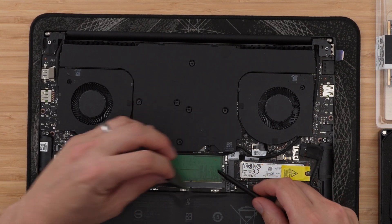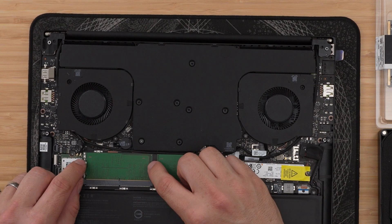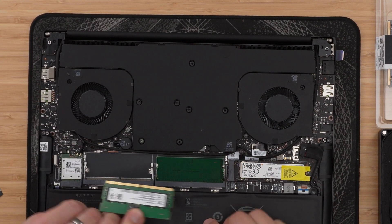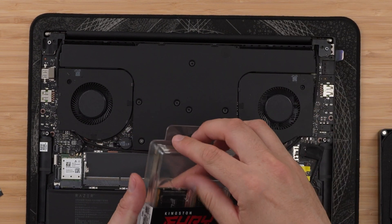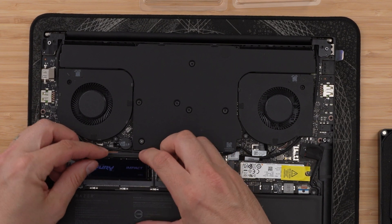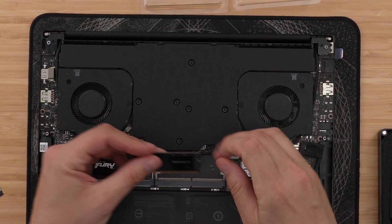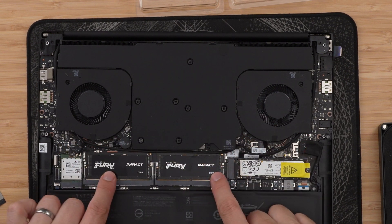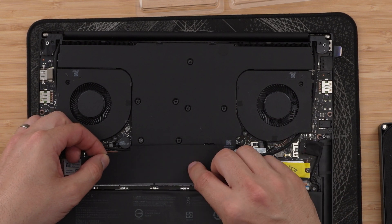The first thing I'm going to do is change the RAM. You will notice there's some mylar or plastic over the top of these RAM chips. This is just on with some very light adhesive - you can just pull that straight off and put it to the side because you're going to use it again afterwards. We're going to then unlock the retention clips either side of each RAM module, and those RAM modules will spring up, allowing you to pull them straight out. We're now going to take our Fury RAM sticks and put them in at a 45 degree angle so it sits into the connector. Once seated, push that RAM stick down towards the motherboard until you hear those metal retention clips click into place - it's a nice satisfying thunk when it goes in. Do that for both RAM chips. We're going to stick the mylar back on top of those RAM sticks just to give it that bit of extra protection.